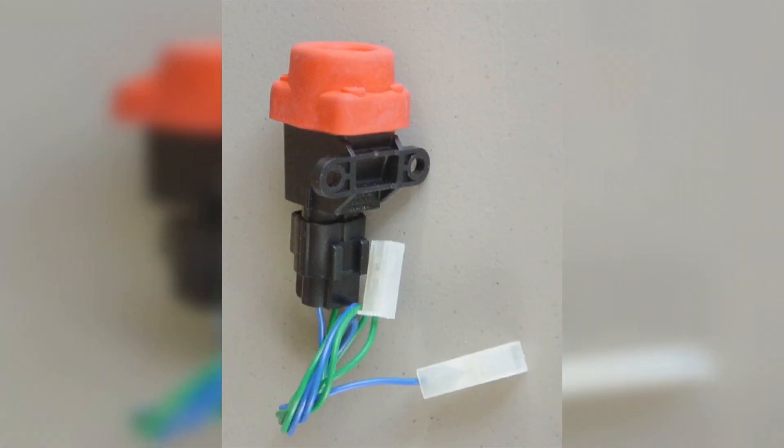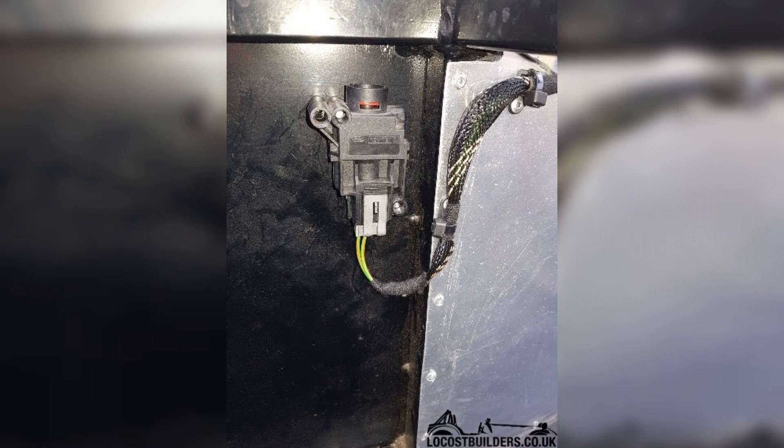In many modern models, the inertia sensor is placed near the driver's airbag, which means false alarms — such as those during emergency braking — cannot be ruled out. To resume fuel supply, the driver must press a button to force the fuel supply. Manufacturers place this unit at their discretion. Main locations to look include: under the dashboard on the driver's side, under the driver's or passenger's seat, under the hood in the area of the gas pump, in the luggage compartment, or under the glove box next to the front passenger. If you cannot find it, refer to the manufacturer's operating manual or contact your dealer.